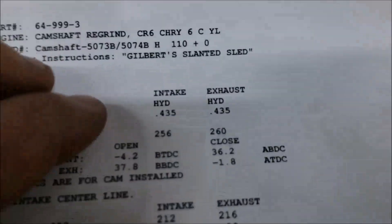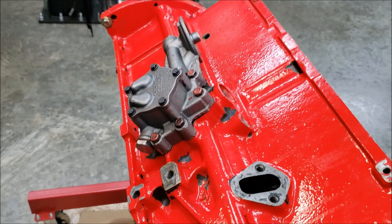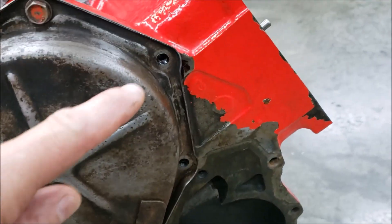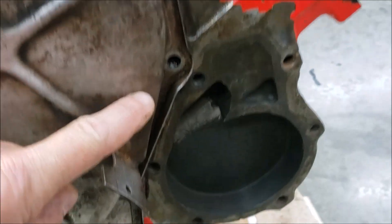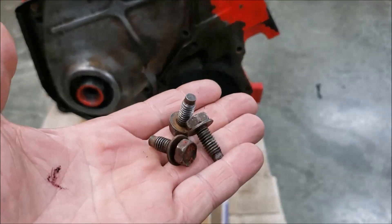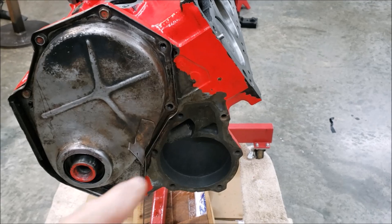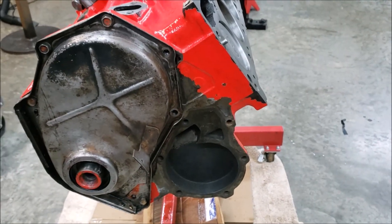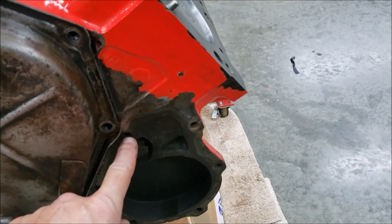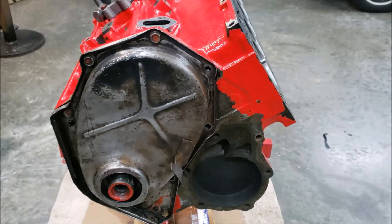One more thing - the oil pump is on. Here's a little tip: that hole goes into oil, that one goes into coolant, and that one goes into oil for the timing cover. So I put a little sealant on these three holes. That will seal it up - especially that one that goes into the coolant. I've seen a pretty bad coolant leak from that. Also, when you do the water pump, this one also goes into the coolant passageway. That one was blind and so was that one - just heads up.